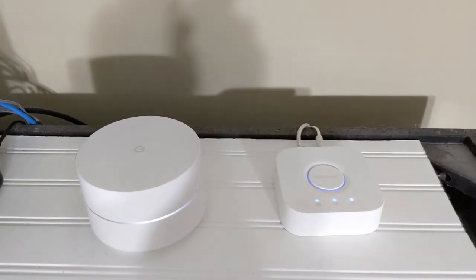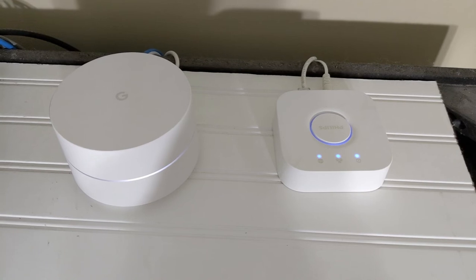For most of the smart lights in my house, I run Philips Hue. It comes with lots of different options — in my house I have two types: one bulb that is a single incandescent warm white color, and another that ranges from warm white to daylight. I don't have any multi-color bulbs, but that is a third option available. To run Philips Hue bulbs, you need a hub connected to your Wi-Fi. To connect any new bulb, you simply push the button on the hub, it finds the bulb via Wi-Fi, then you open the app on your phone, tell it what room it's in, name it, and you're set. From there you can use Google Assistant, Alexa, or any other smart home device to control features like dimming, turning on or off, or changing the color.